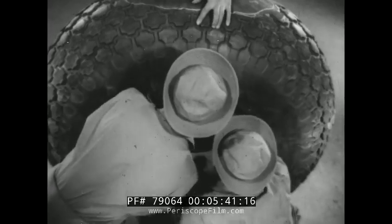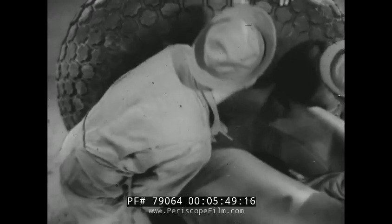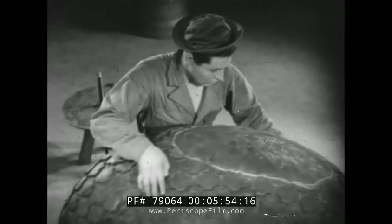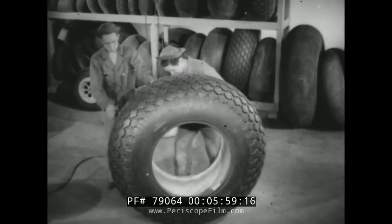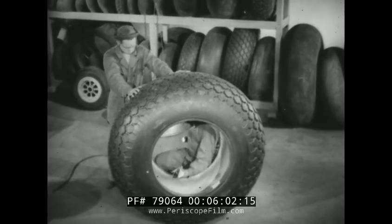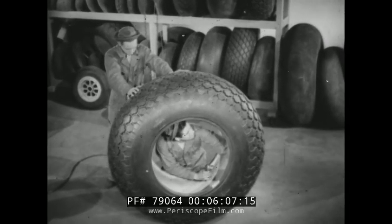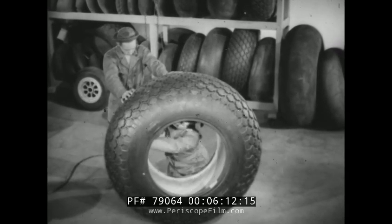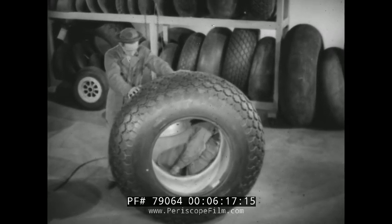Another picture covers detailed inspection and repair. Since this tire has a flat spot large enough to throw the tire out of balance, it will be set aside for retreading and replaced by a new tire. Before being mounted, all casings whether new or used are carefully inspected. The inside of the casing is thoroughly cleaned out. Someone might have tampered with a new casing or it might have foreign objects on the inside; it should be as carefully inspected as a used casing.